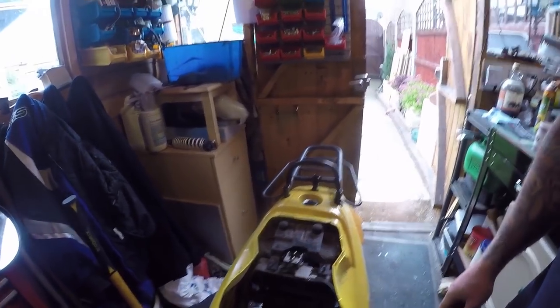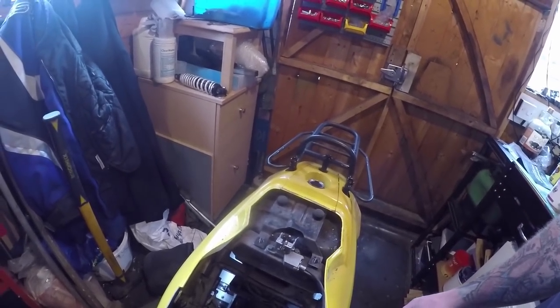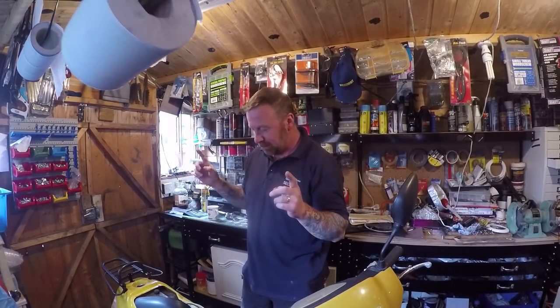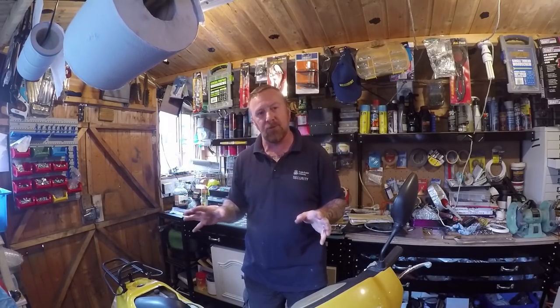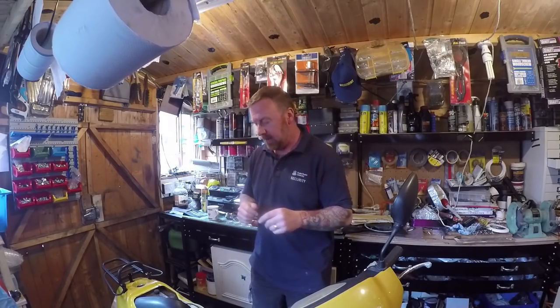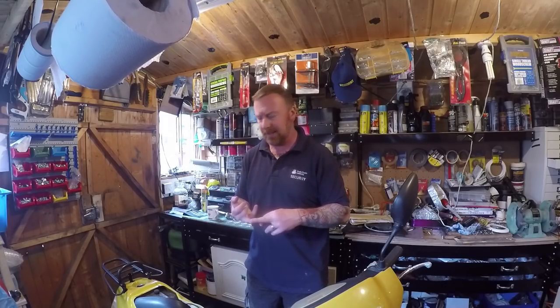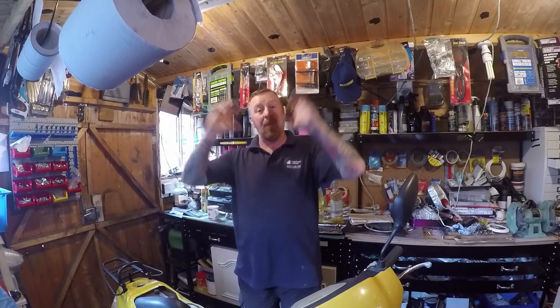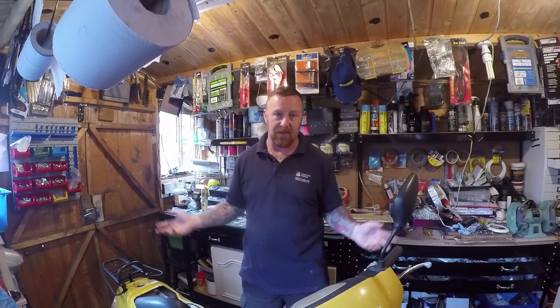A metal tank — oh, that's unusual! We are talking a complete, cheap, plastic bike with a metal petrol tank. Panels off, get this tank out upside down. You cannot just drain this petrol out of this one — there's a filter inside. It looks like a little stick. Change the inline filter, clean the vacuum. Flush the whole thing out with fresh petrol — get all the bits out. If you don't flush it out properly upside down, little bits will go back in and you'll have the same problem again. And it's going to need a carb clean as well.